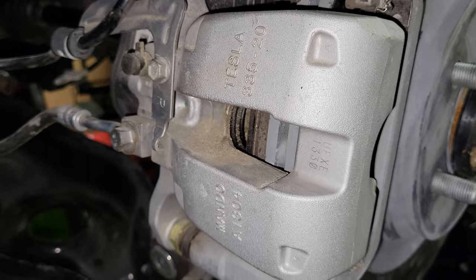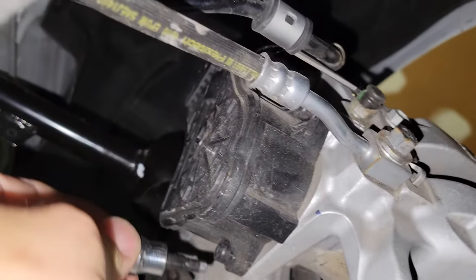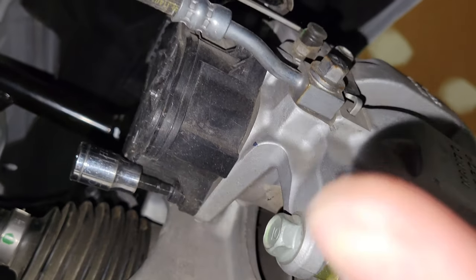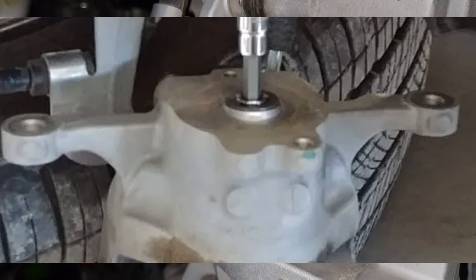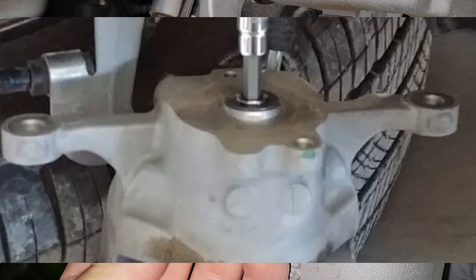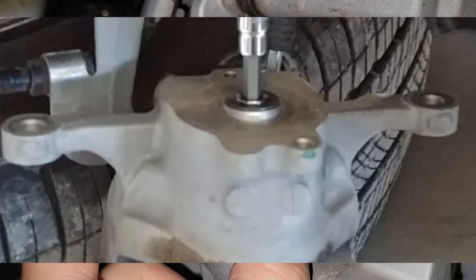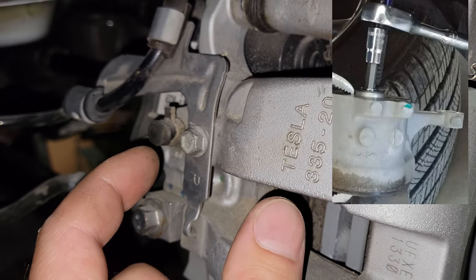Let me show you how to do that. You'll have a 5mm Allen head bolt that you'll see here and here, and you'll have a socket or an Allen key that you'll place like so. You'll remove both those bolts and pull this unit straight out — be careful, it should come out fairly easy. At this point you should be looking at a caliper like you see in the picture above. You're going to take a 6mm Allen key and turn it clockwise as you put a light clamp on the piston, as you'll see right now.